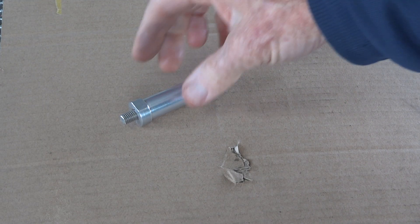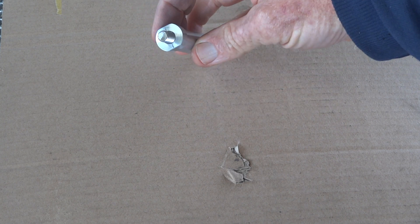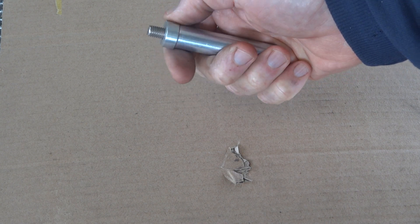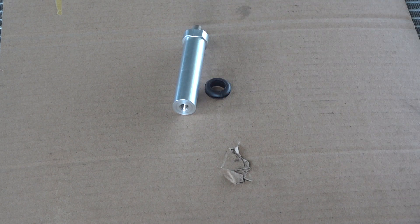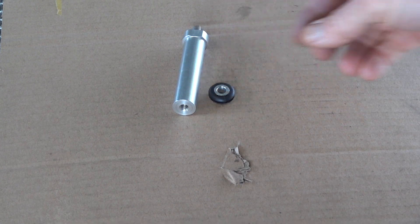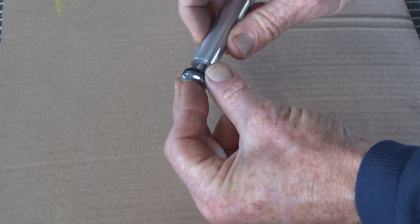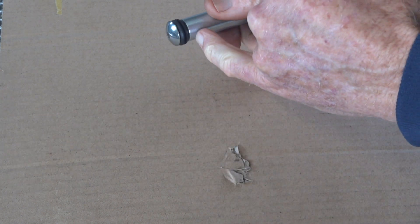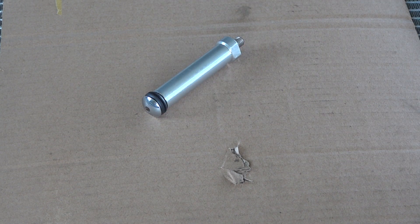Here's our little upper radiator mount — a bit of aluminium with an M6 thread in one end, M8 the other, and a little bit of threaded bar screwed in there with a pair of 17mm flats filed on there. And the other end — always good to soft-mount radiators — so that's a grommet. A little spacer goes in there, that's our big-headed bolt. Screws in the end of that thing. Then a little bracket goes in the slot in the grommet and that'll work out nice and soft, nice and strong.